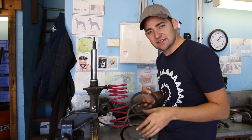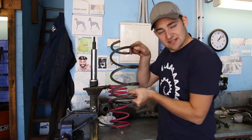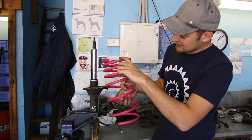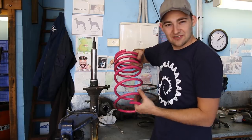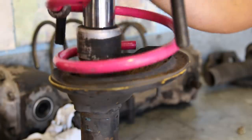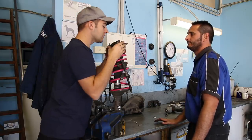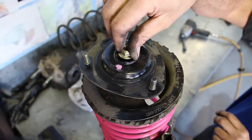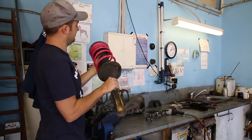We've actually got three sets of springs to choose from. There's the ones already in the Liberty - just standard 2.5-litre shocks and struts. These are the GTB ones from the import, which are probably better than what we've got. But we've also got these STI pinks, which have more coils at the top - that means they're progressive springs, so you still get the comfort from the big coils at the bottom, but when you're giving it a go this will give you more stiffness through the corners. Adjustable coilovers are often seen as the cure-all for suspension but can sometimes ruin a road car by being too stiff. Being that this is primarily a street car that needs to carry humans in comfort, we're going with a quality shock and spring setup, which should get us decent ride quality, decent handling, and enough lows to keep the internet happy.